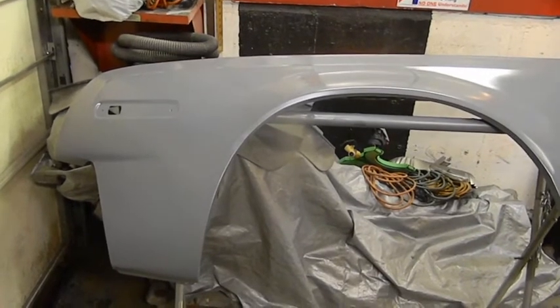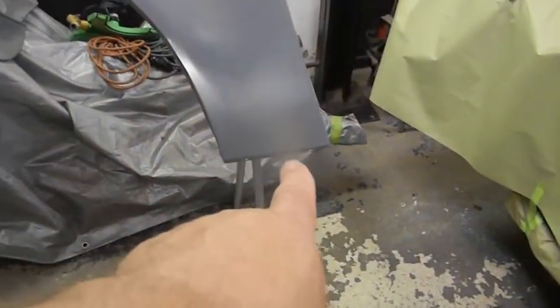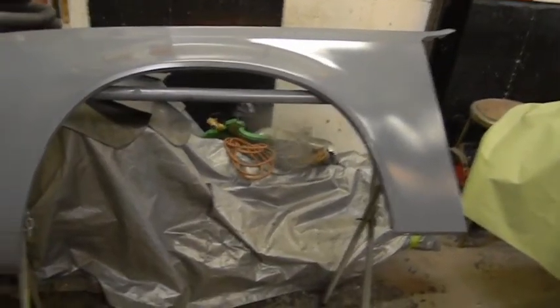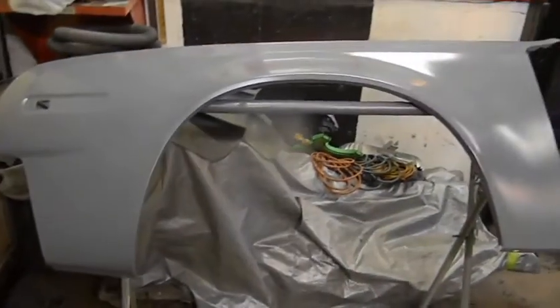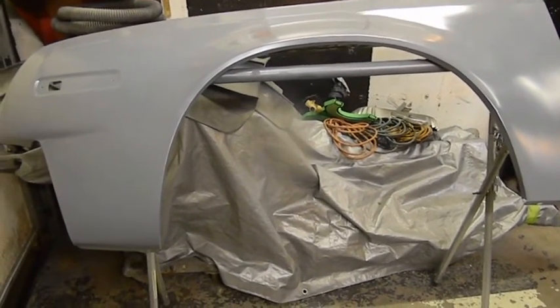In this case we're doing it to protect the metal, so two coats of epoxy is more than enough — you're not really trying to fill anything, just protect the metal. We got all around the headlight door area, the whole wheel well, the front lip, the back lip inside the car, the whole jam area, underneath there, and the back side where we bolt it. Pretty much the entire back of the fender is protected. There's also a tiny outward thing there, but the molding covers it — that would have been fun with a little pick hammer on the barn door to fix.